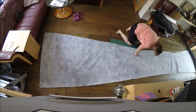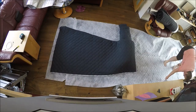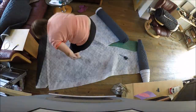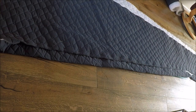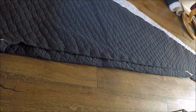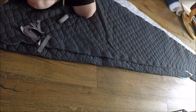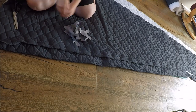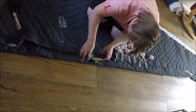I'm going to cut the two long sides and the short back as a single very long piece and then fold it over and cut a mirror image piece so that I've got a double-sided curtain. I'm cutting it as a single length because I really want to be able to close the roof bed with the insulation in place — there's enough room up there for us to easily leave duvets and so on. I'm worried that if I cut each section individually and then velcro or zip them together the extra seams will mean the roof doesn't close easily. I've actually cut one piece larger than the other to make it easier to attach the velcro at the top and the bottom whilst keeping the bulk down, and that's given me the opportunity to stitch in some lightweight webbing loops that we can use to hang fairy lights from.